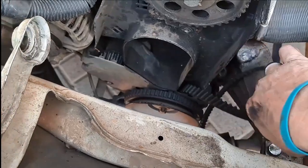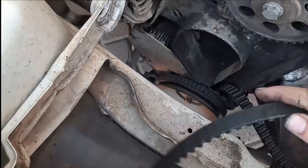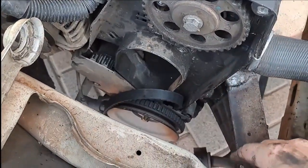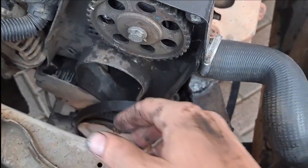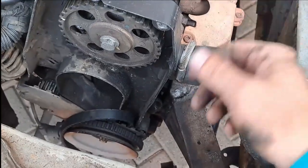While I was trying to remove the bolt on the crank the timing belt snapped. I don't know why the bolt was that tight, but I was anyway planning on putting in a new timing belt and tensioner. This just made the stripping a bit more difficult since the crank is not sitting freely and there's nothing I can do about it.